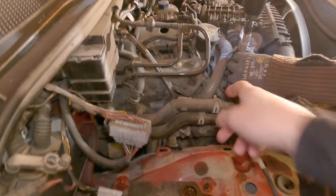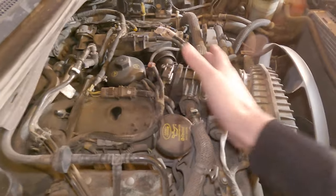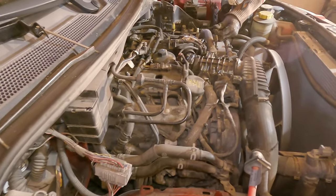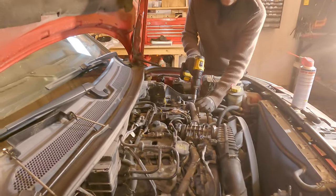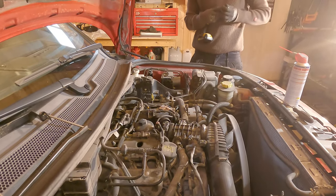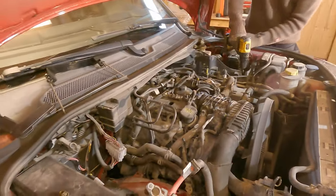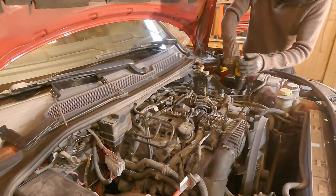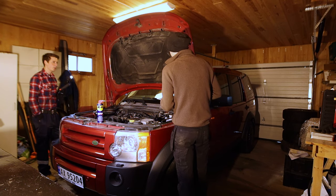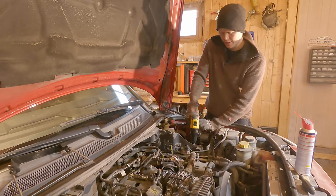When they blank the EGR valve, they just remove this pipe and add a cover there and up here, and also remove the butterfly valve which just sits in here. You can do this without getting the warning lamp in the dash on 05, 06, I think. From late 07 you can't. Then you need software, EGR removal software. And if you've got a DPF, you can't blank it, because the EGR is used to regenerate the DPF, to get the heat up, or they have to stay closed.